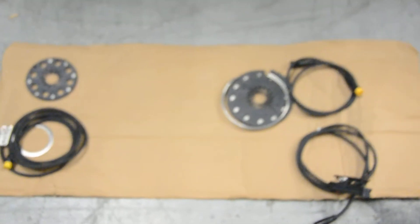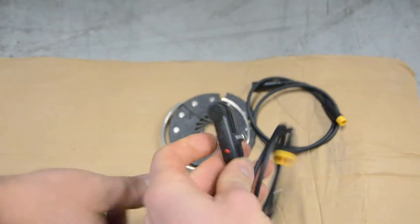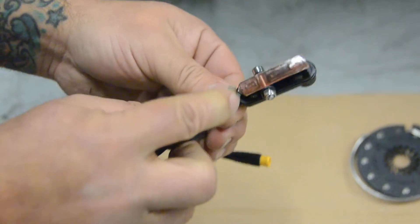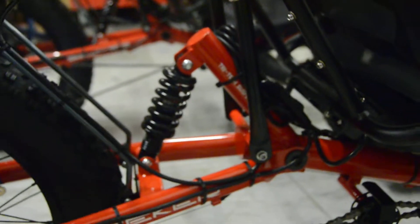There's one other thing that you may need. If you're getting an e-bike kit from us, we like to equip you with a left hand pedal assist sensor, which you see over here. This is our easy pedal assist sensor that mounts onto the seat tube of most bikes, or in this case the mast for the front derailleur. You peel off the adhesive, stick it on, and zip tie it in place. You've got the two-piece pop-apart magnet disc that joins with that, and then you'll need an extension cable to run from the controller at the back of the bike all the way to the front where you have the pedal assist mounted. You may need two of these cables if you have extra long legs.